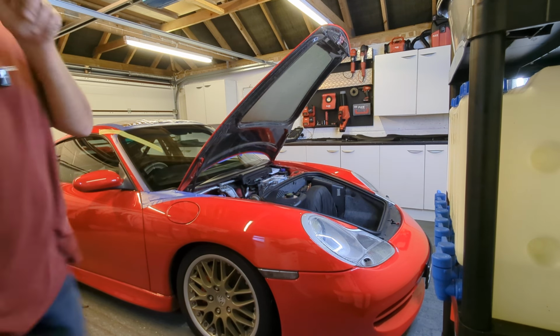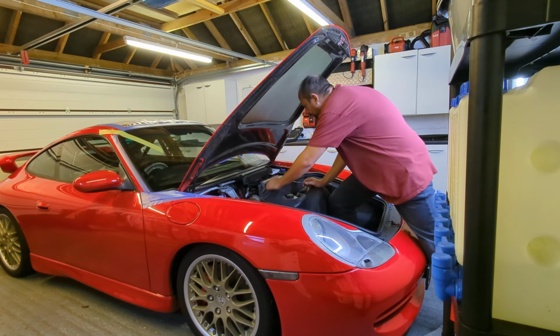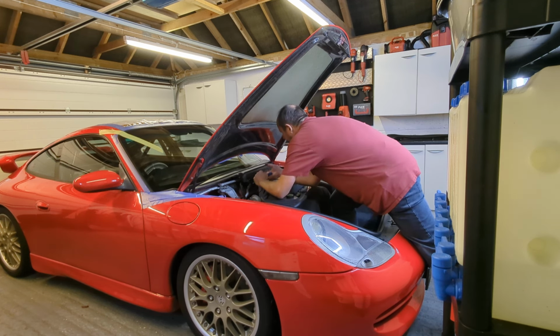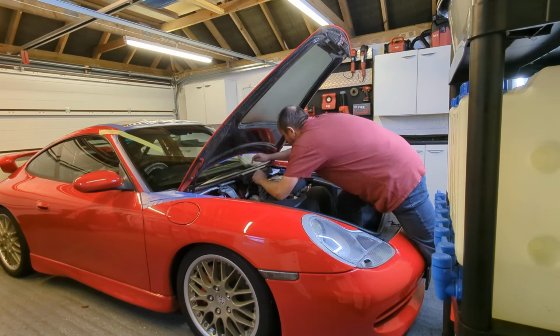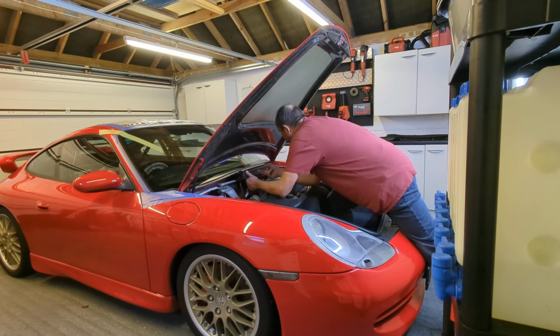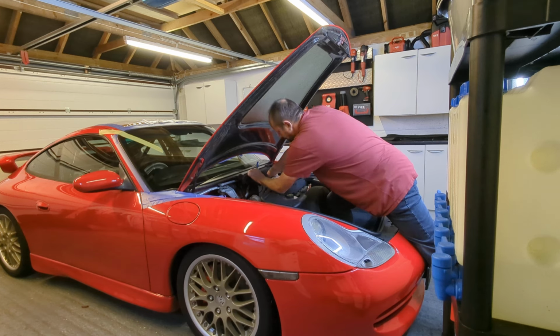But yeah, I think the glass is the high risk bit, because it's taking out glass and putting it into another car. It's risky business. Just before I do this, I want to have a look. I want to make sure that the metal clip on that top side of the scuttle was in place. Why is that? Oh, okay, that's just hitting that pipe there. So I want that to drop in properly. Make sure I've got all my electrical connections out the way. I want that to just drop in. There we go. Let's take that screw out.